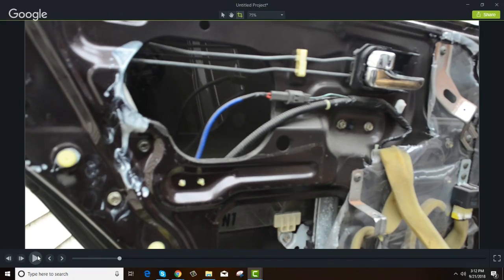You don't have to get the door panel all the way off — sometimes you cannot get it all the way off without breaking it. If you can get the top back just enough, you'll have enough room to reach the stiff rod down in there and move the mechanism up or down while spraying some lube in there. Make sure the door is unlocked and pull up or press down — nine times out of ten it's up — while pulling on the inside or outside door handle.